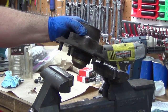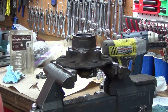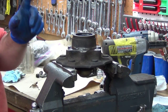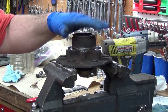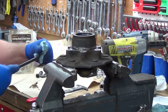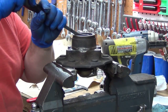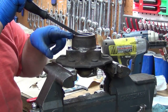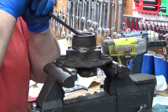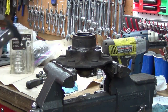Alright, I put the rubber jaws in. Most guys don't have a vise that opens up wide enough to grab it like that, but this is a seal puller. It makes easy work of getting in there and yanking that seal out, and it will kill it. You can sometimes, very carefully with a pry bar, pull the seal out to reuse it, if you mess up your seal or whatever. Now the challenge is that you're pushing down on this side and you're likely going to dent it, but you've got to try to get down underneath there and catch the metal. So you could try it.